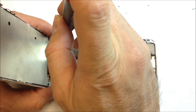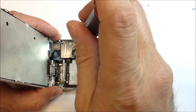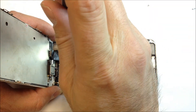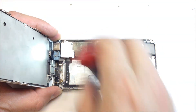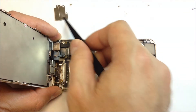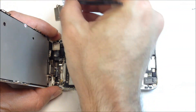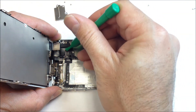Keep in mind that one screw has no way to stick to the screwdriver because it is not affected by a magnet — not sure what it's made out of, but I'm sure there's a reason they use it. I would recommend you try not to go too far with that last screw; if it stays in the plate, great. More than likely it will fall off inside the phone, so if it's not in the phone it'll be somewhere on your desktop or on the floor. You'll see here when I lift the plate off, the screw actually fell inside the phone, so I've got to pull it back out — and that's going to be fun putting it back in since it won't stick to the screwdriver. I'll show you in the next video how you can get that screw in with minimal effort.